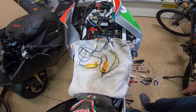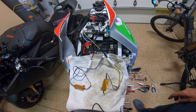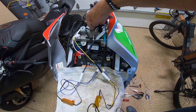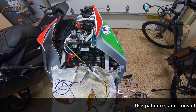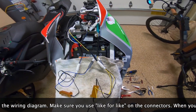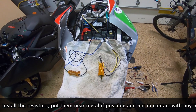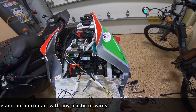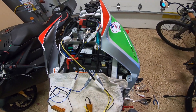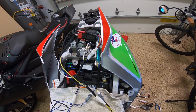I want to show the wiring installation here. It takes a while to sort of figure out, but there is no splicing — it's all plug and play. I have lots of extra wires and my next challenge is going to be tucking it all back underneath, but it does work. They give you a choice of using or not using the resistors. I put the resistors in line, checked the operation, and it works well — I get the flash, I get the sequential turning and all that goodness. I'm going to leave them there, and now to button it back up.